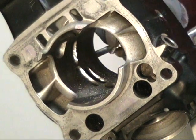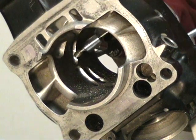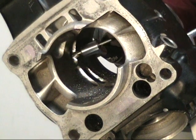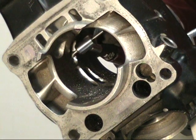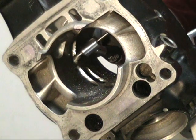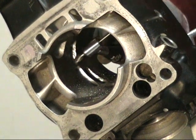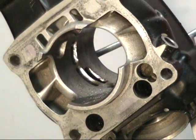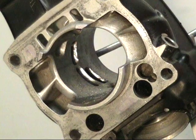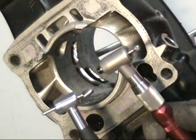Now, what happens when you get over to this? Say I want to work this transfer port to angle more towards the intake side, which is sometimes ideal because you want that column of air towards the intake side instead of straight across the piston. How do I do that from up here? When you get in this angle, see that little jumping? It's simple — use a left-hand burr. This is a 1MC with a left-hand unit, but you can also use a left-hand burr with a 1A2.